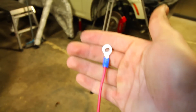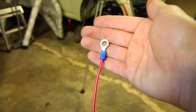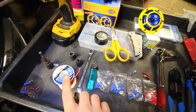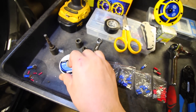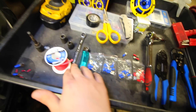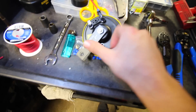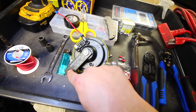I'll connect this little piece right there on the back of it and insert a bolt or nut through it to make a good ground. To get those little wiring harnesses — the little connectors — I used everything you see here. I started off with a little roll of wire, which I used to make the connector go from the horn to the ground. I used a 13mm ratchet to loosen up the nut found on the backside so I can adjust where the wiring connectors are in relation to where it's mounted.